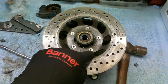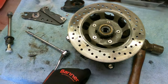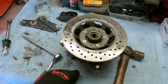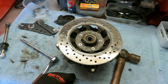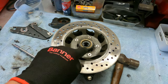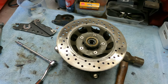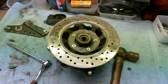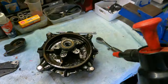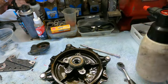It's just a case of undoing these five bolts, taking it off, giving the disc a clean, giving everything a proper clean so it's not all manky, and getting rid of the years of crud that's built up around it. We'll clean all of this and re-grease it. I do have a new one so I could put a new one in but we'll see what it comes up like. Then we'll refit it along with the anti-dive, which I'll show you about in a bit. Good old brake cleaner — when we put the new disc on we'll also clean everything up with brake cleaner to make sure it all works how it should.